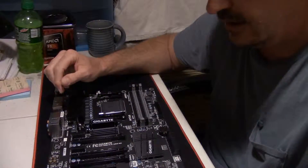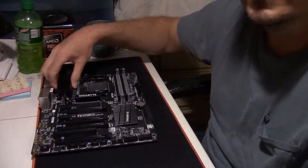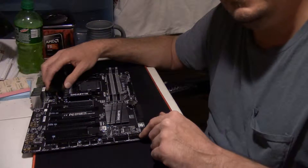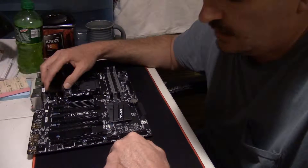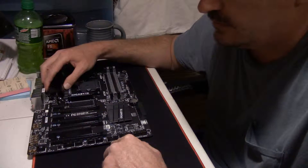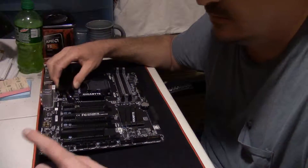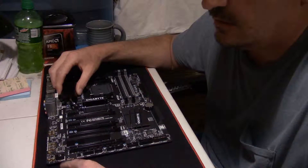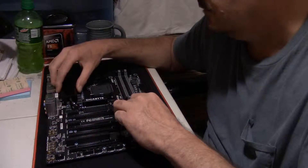So you don't have to worry about which ones are SATA 3 and which ones are SATA 2. Down here in the bottom corner you can tell it's all different colors — that's for your power switch, reset switch, power LED, and drive activity. You've got your USB 3 header and then three USB 2 headers for your front panel connectors, depending on what connectors you have for USB ports on the front of your case. You also have your front audio header, and there's system fan 2. This thing has only two system fan headers and one power fan, which is plenty for me — I only run two fans in my system.